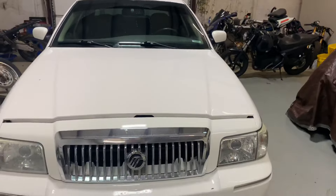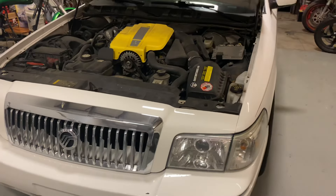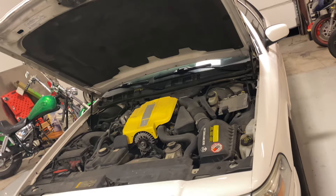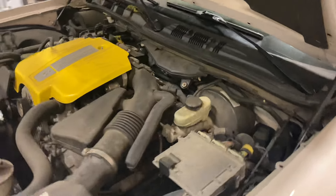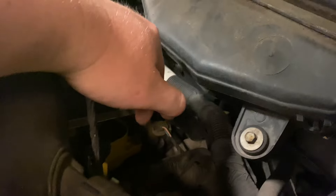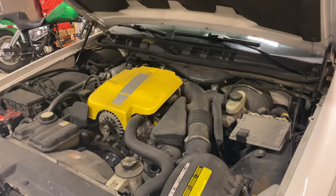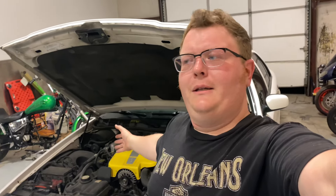One other thing of note: the factory didn't get everything right. If you park these cars on an incline where the driver's side is sitting a little lower than the passenger's side and it rains, water will pool right here and run straight down into the number 8 ignition coil — and it can't go anywhere. It just sits there and pulls down the spark plug tube. The next time you fire up your engine, you will very likely short it out. I have gone through like three of them. So just try to park it level, or park it inside.